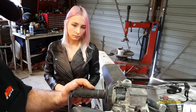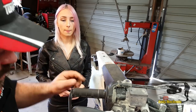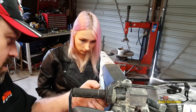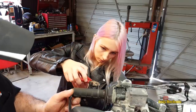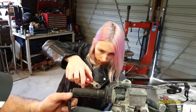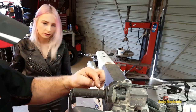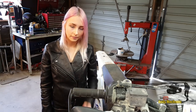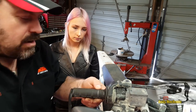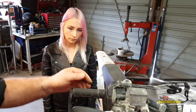We need the snippers now. Leave about a 10mm tail — so maybe 10mm up from the grip — then snip it off. Bend that tail down onto the grip using the flat metal surface of the snippers, just to push it back. You don't want to use your finger because you might stab it. With a bit of use, the end will get dug into the bars and be out of the way. And you've got gloves on anyway when riding, so it's not really an issue.